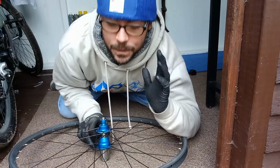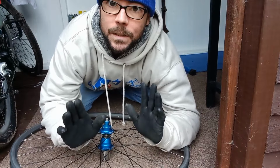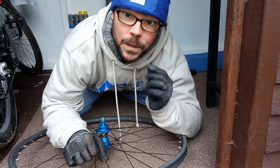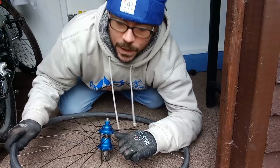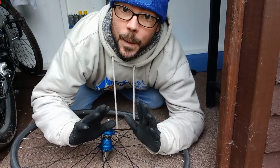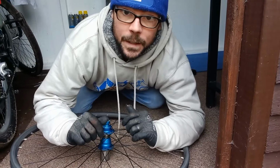And what I'll do is I'll generally do that probably 10-15 times throughout the stressing truing process, because as I get closer to getting this all built up, I'll make those adjustments ever so slightly smaller as I'm truing it up, and then I'll keep checking it, keep checking those tensions, keep checking the dishing, and then go from there.